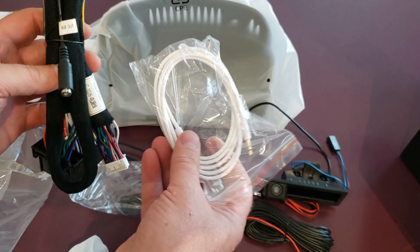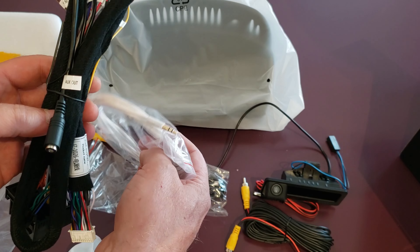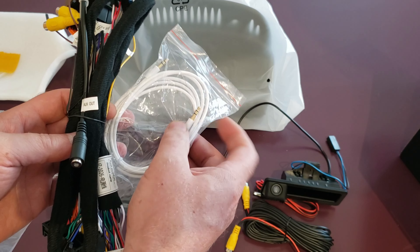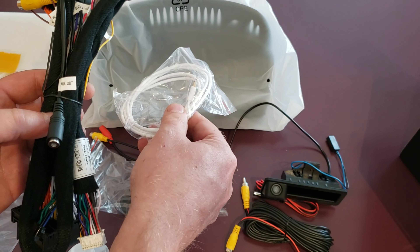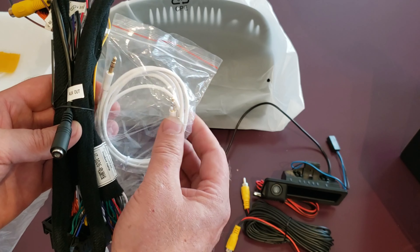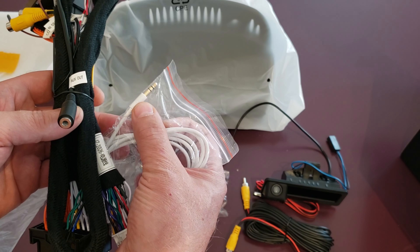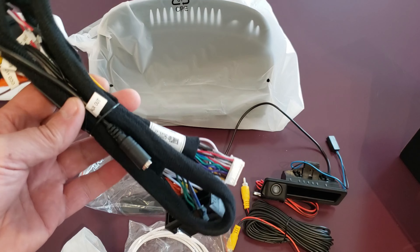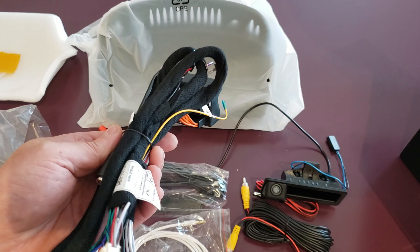They do give you a cable. My car didn't have the auxiliary connector, so I actually bought an auxiliary kit off Amazon — I can put a link below — that has the male end. The stock car normally comes with the female end, so you plug one of these into your phone and then into the car. But I didn't want an extra cable in the way, so I got a cable with the male end on it so my car connection plugs directly in without this cable. If you have an existing system, your jack looks like the female version and it'll be either in your glove box or at the back of the center console.